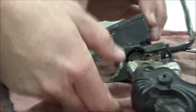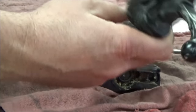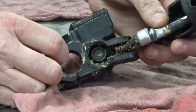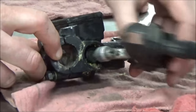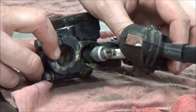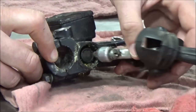That divot means the brake lever was literally banging around and this screw was banging against it. That means there was probably an excessive amount of free play in here, so this was able to sit and vibrate and bang the end of that piston. When we do our rebuild kit we get a new one, so we don't have to worry about it.